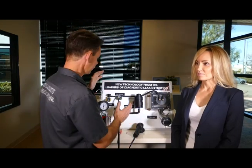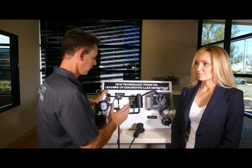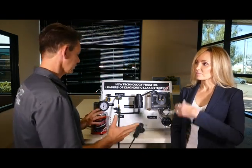If it's a large EVAP leak, one of the best ways to test for it is to hook up a smoke machine. You inject smoke into the system and then close it off — the purge valve is normally closed automatically, but you need to close the vent system off to seal the whole system. Now you're able to look for leaks. If it passes that, you go to the computer side and look for pressure sensors, leak detection pumps, and those types of things.